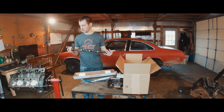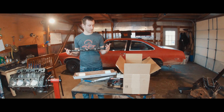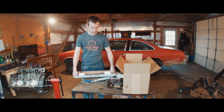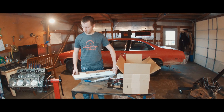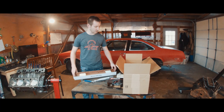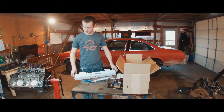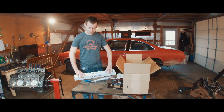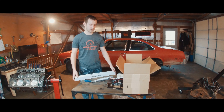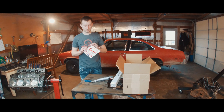This shouldn't be anything too far above stock but it's definitely the highest I could go without doing a torque converter swap. I wasn't sold on doing a torque converter swap, so I just wanted to wait and see where we're at once we got the engine in there - if I decided that I needed a higher stall or not. I figured this was a good start.